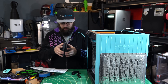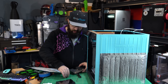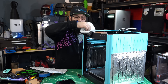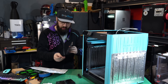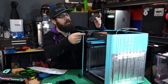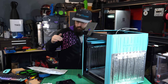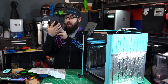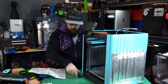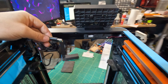The back of this comes off — it's just magnetic. We attach the bracket with some of the screws included. Then the mounting bracket attaches with VHB tape, so give the surface a quick wipe down with some isopropyl alcohol — make sure it's clean and free of grease. Peel off the backer, then line up the right side of the bracket with the right side of the screen, eyeball it right about there, and push that down. Once we get the bracket on there, there's a power switch on the back — it comes set to off, and we're going to set that to DC 5 volt. Then the Panda Touch snaps on, and we connect the USB-C cable to the USB-C port.